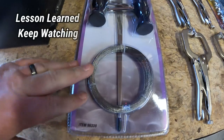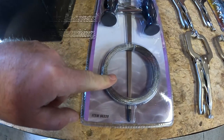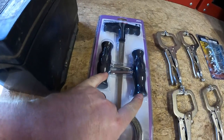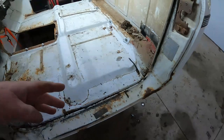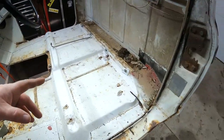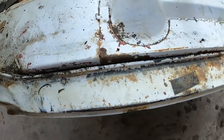This is what we're going to use today — this is your window removal kit. You have a little wire that goes into the jam, a little tool to feed it in there. You can hook up your two sides here to the wire and then start sawing back and forth. I believe I have enough metal work here and I'm going to have to brace this cab up so it doesn't tweak on me.